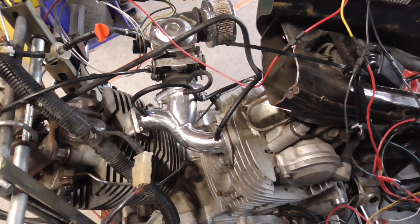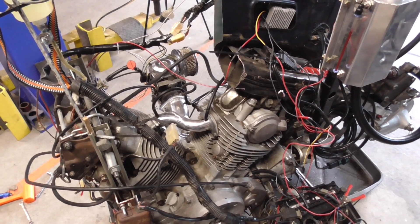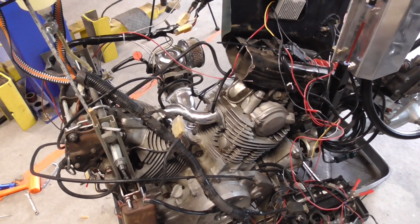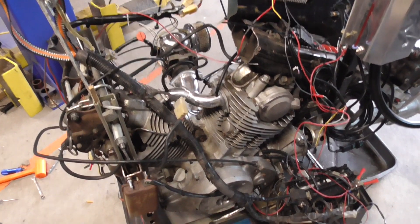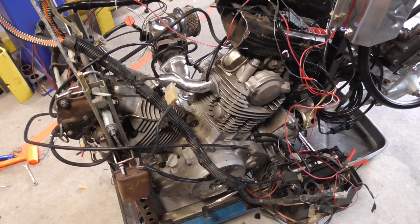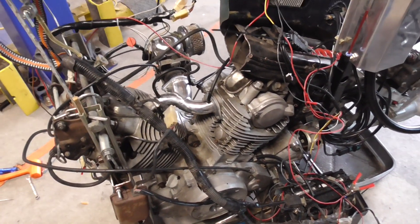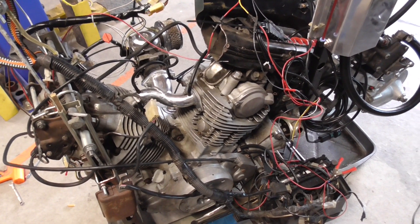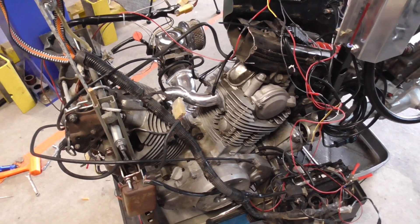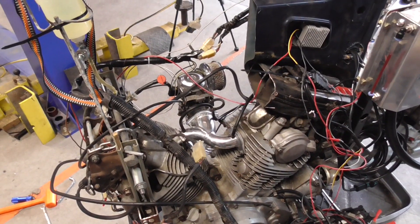I'm thinking that maybe it's got something to do with the uneven firing of the cylinders. I'm wondering just what effect does that unequal fire on these Virago motors have to do with the front cylinder always wanting to be lean on a single carb. So we're going to get set up and I'm going to actually change the timing on one of the cylinders — move it 180 degrees out — to see if I can make the front cylinder lead and then it'll run richer. The rear cylinder is the following cylinder once I set up the timing. We'll show how to do that, then we'll test it. But first I'll show how it's running right now with the standard timing and with this single carb intake.